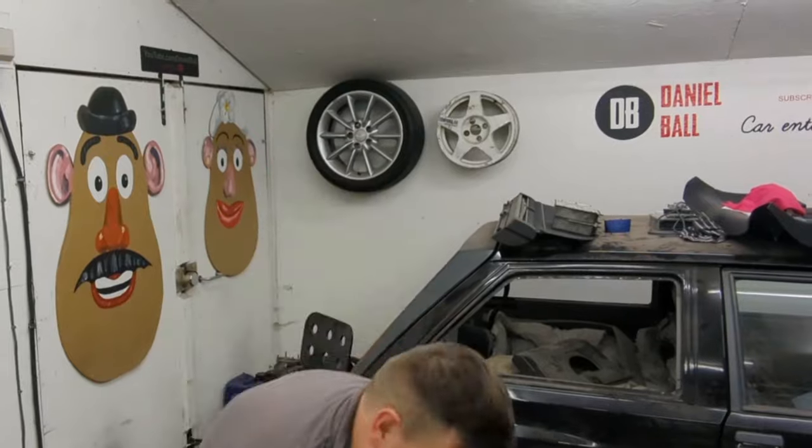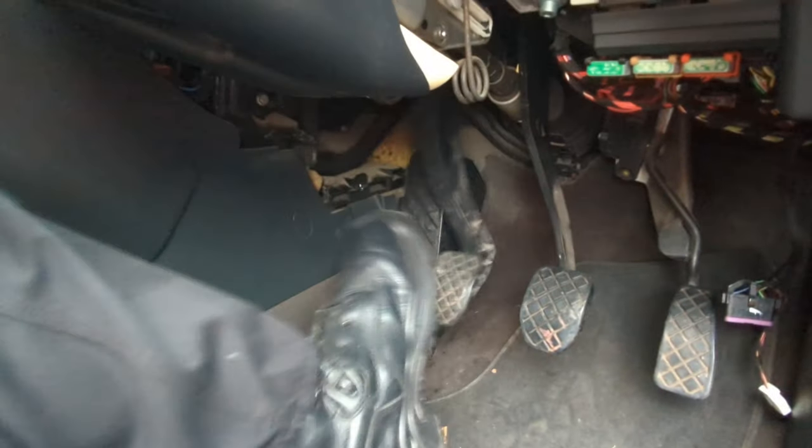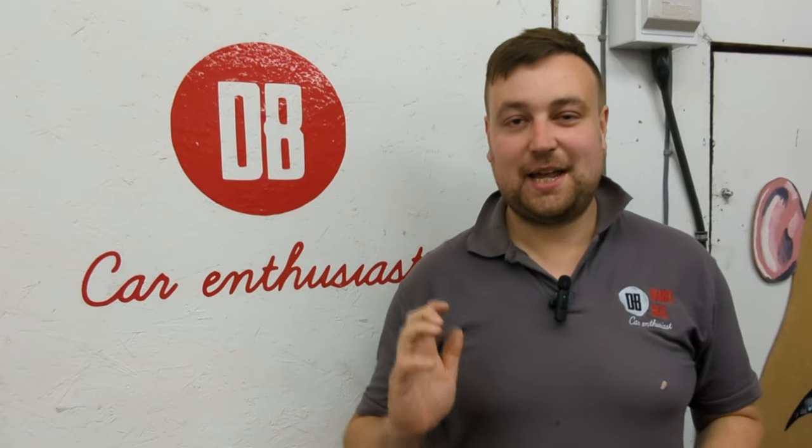At this exact moment everything goes wrong for me — you can spot the problem, comment below. So I bolt everything up in reverse order, everything goes super smoothly, until it comes to taking the vehicle off the lift. I press the clutch and the first three-quarters of the pedal is really soft and the last bit's fairly hard — instantly I thought this isn't right. We try re-bleeding it and doing lots of bits and bobs, but to no avail. If you start the vehicle up you can't get it in gear; if you put it in gear and then start it up it will slightly push forward — not fully, it's not like the clutch is all the way up, it's just not right.